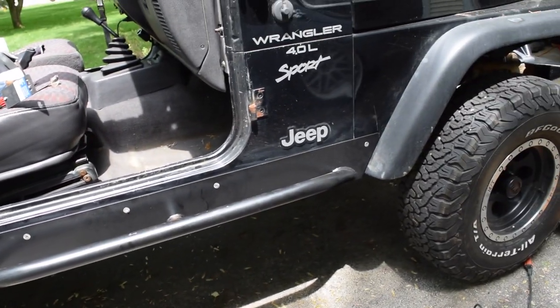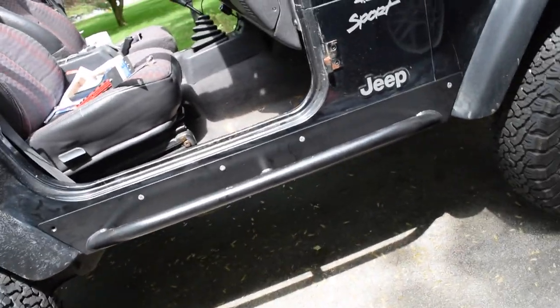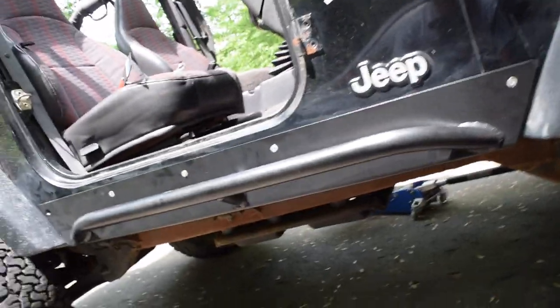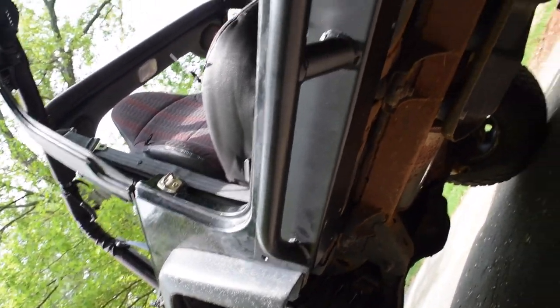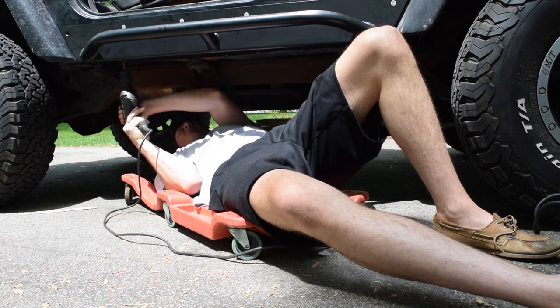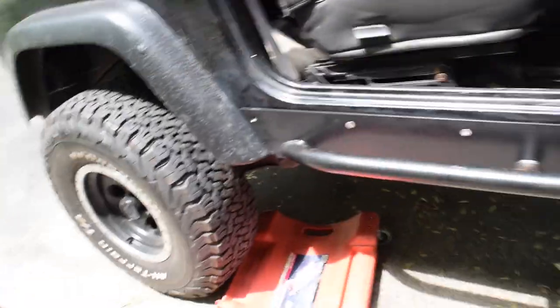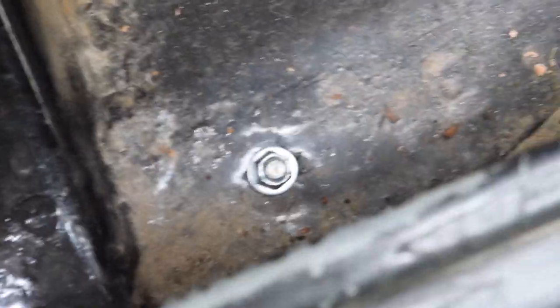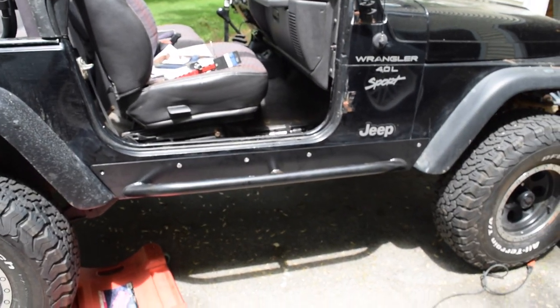Once you have the side bolts fastened tightly, I've removed the jack — it's holding up on its own power. Surprisingly I didn't screw this up and it looks like it's working. Now you have to drill the bottom bolts — there are four of them. To do that you've got to pull the carpet and your tool kit out of the way. Once all the bottom holes are drilled, come up top, put the fasteners through — one, two, three, and four — and just tighten those up.